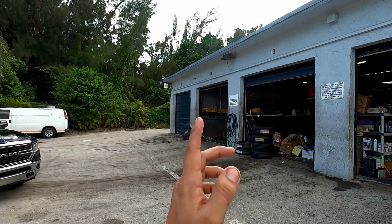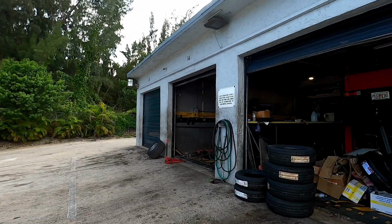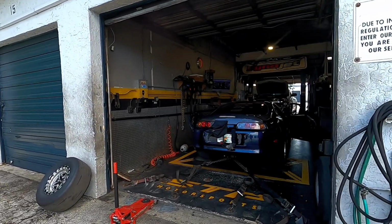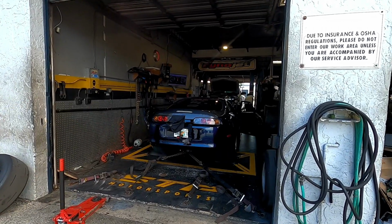We're not gonna boost that much, but nonetheless, we got a 7-bar MAP sensor in there now, and he was also getting the second set of injectors to come on. We had one that was acting up a little bit on us, but he got it figured out. So all 12 injectors are on there. We'll start progressively tuning on it now.